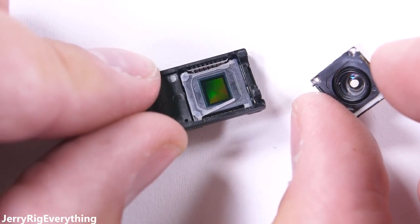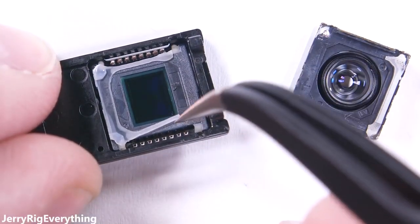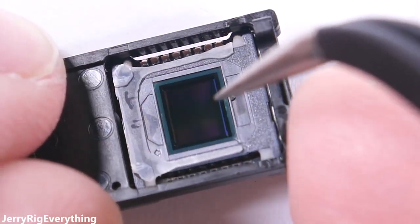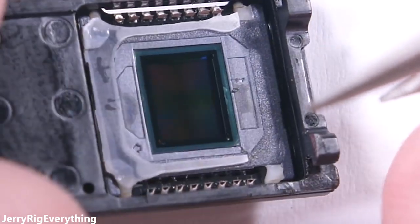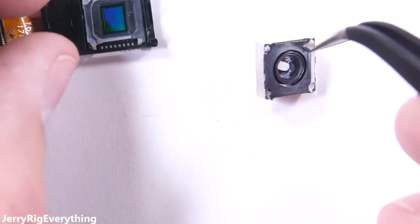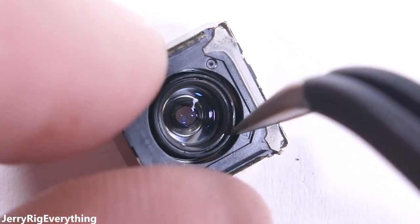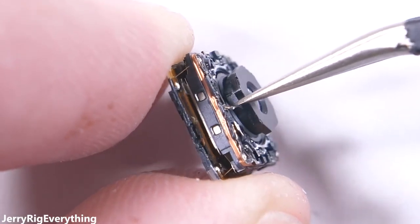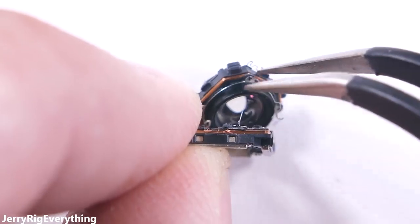These colors help improve contrast and definition of the image. I'm a camera guy, and I use my cell phone camera quite a bit, so I'm pretty excited about this big step up in camera power. Most computer screens can't even display 10 bits of color yet, so this camera is really leading the curve. But even if your monitor only displays 8 bits, the extra shading 10 bits can pick up will still enhance dynamic range on your 8-bit monitor. To fully utilize this 10-bit sensor we need light, and there is an F1.6 aperture lens inside this plastic housing — a world's first on a cell phone — meaning more light hits the sensor than any other cell phone on the market. The hardware is pretty intriguing, and judging by my initial helicopter ride, the software looks like it's keeping up so far.